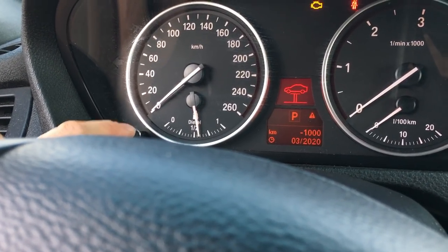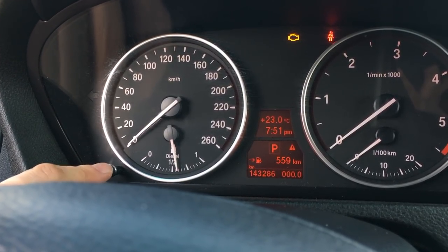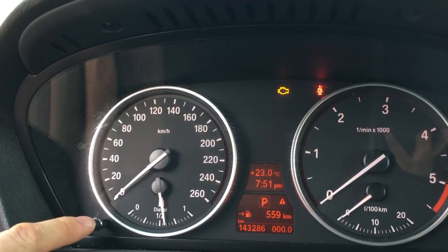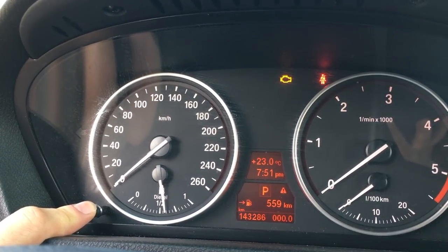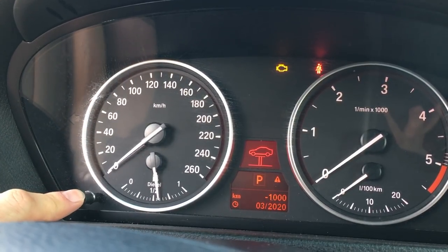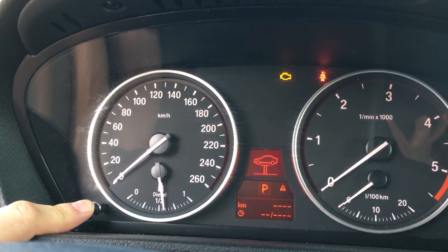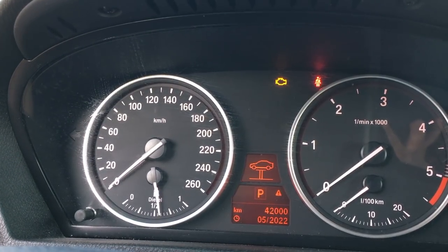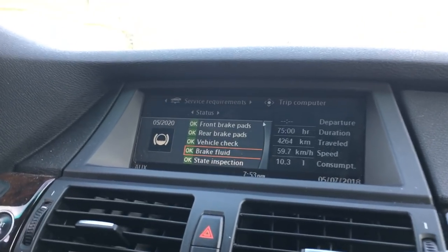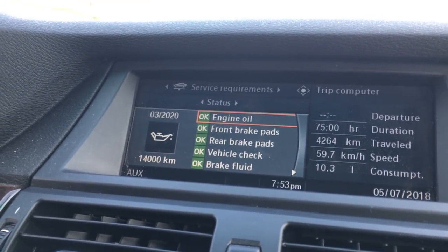Now you also have the service. I'm going to eliminate this service code because, to be honest, we do a pretty good bang-up job of maintaining our vehicle. So I'm going to show you how to do the full service reset. Press and hold, and press and hold again — it's going to ask me for reset. Yes, let go, press it again, hold it. Boom, and away we go. Now as you can see, our brake fluid is fine. Brake fluid and vehicle check are all okay on the iDrive system — or the xDrive system, depending on your flavor.